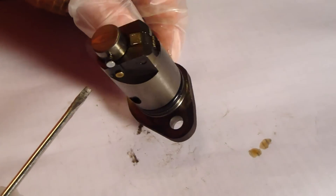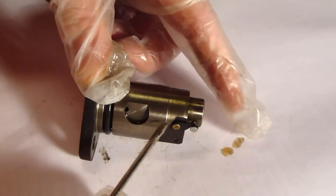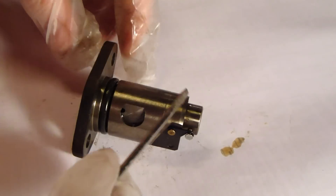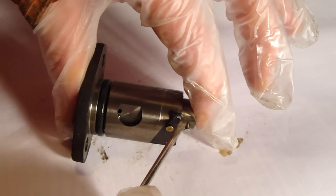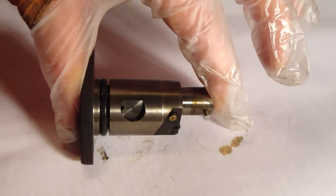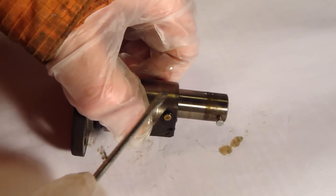When we install this tensioner back in the engine, we take these bolts in here. Then in the final step we need a screwdriver and we need to press this small plate carefully so that the system starts to press, because right now this tensioner doesn't press anything. We need to take that clip away, and then it starts to do this pressing. There are teeth so that when it goes one step you hear the sound, and then it doesn't go back anymore — it automatically ticks to the right position.